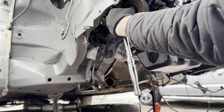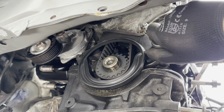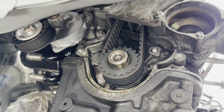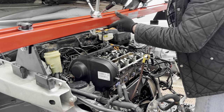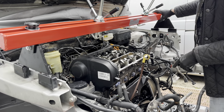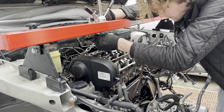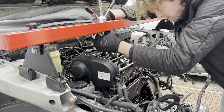Remove the crankshaft pulley, take out the cover bolts, the cover will fall off. Support the engine with the engine bar. Normally you do this from underneath but with this car the sump is loose and it's too high to get the jack under it, so I just got one of these instead. Careful not to drop the chain on the camshafts.